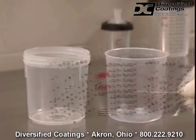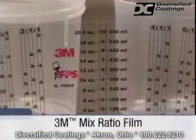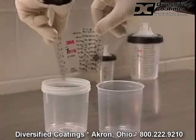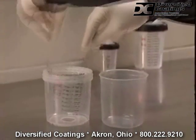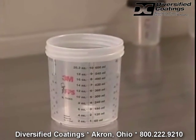The PPS paint preparation system also provides you with another option. The 3M mix ratio film has graduated markings that can be used to measure the material. It can be inserted to read from either inside or outside and is placed in the mixing cup. The liner is inserted and you can now measure the material from the side you chose.